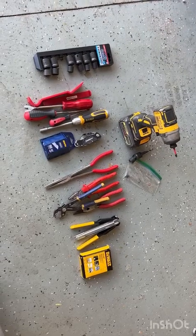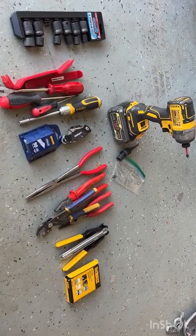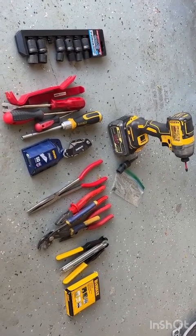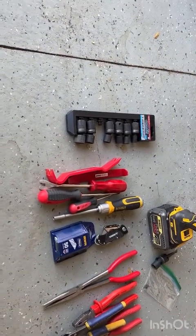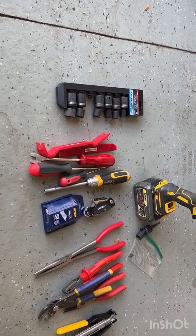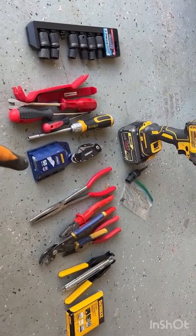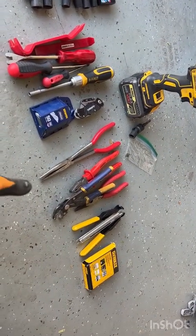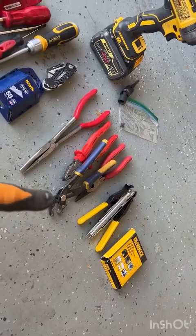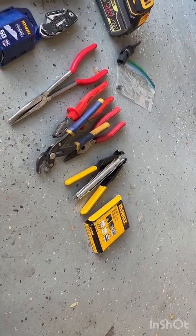The tools you're going to want for this job: screwdriver and or screw gun. I'm a big believer in not doing anything by hand that you can do with a power tool. You just want to be really careful when you're putting screws into plastic. Honestly, even the little fine pitch screws that go into the metal, just be really careful with it. You're going to need a number 12 and a number 14 socket, some trim tools, prying tools. I've got a Christmas tree puller here, various screwdrivers, also mostly just for prying. You're going to want a razor knife and a bunch of fresh blades, because you'll go through probably 2 blades for the seat cushion and 2 blades for the back. You're going to want 2 pairs of needle nose pliers. I found the long ones really helped out quite a bit. And these little mini channel lock looking guys, some flat pliers work nicely, and the secret weapon, the hog ring pliers, and I will show you how to hack the system with those.